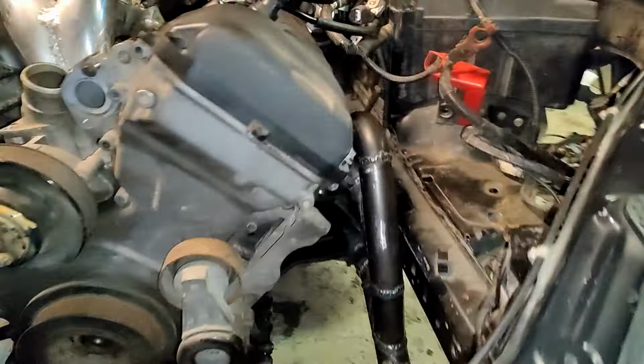And there you can see the exhaust collector, the problematic collector that I needed to fix. And these lines will be taken out, so these are for the original power steering pump. But as we have all the needed connections here, and now the Jaguar has the power steering pump on this side, we will run all the lines on this side only. So those will be taken out. So that's not gonna be a problem either. And then I also created the charge pipe side.